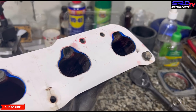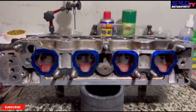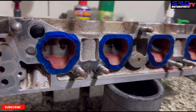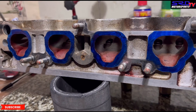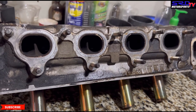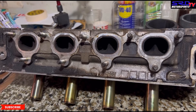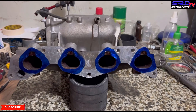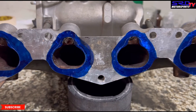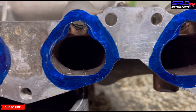Here's the head — it's all ready to start smoothing. We're just going to smooth the first one inch of the entry so the transition from the intake manifold into the port is really good, plus some bowl work. We're not going to port the head completely because we want to keep it as stock as possible — this is a true OEM stock engine so we can see the improvements afterward. On the intake manifold flange we've marked off the gasket we made, and this is how we port match it perfectly to the cylinder head.